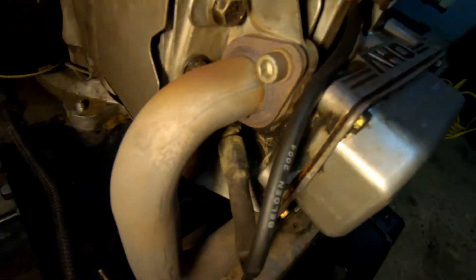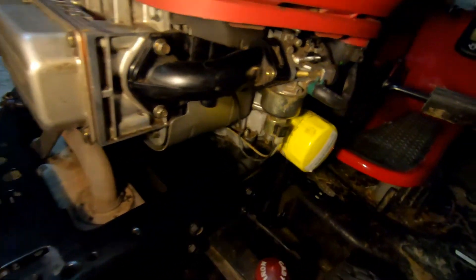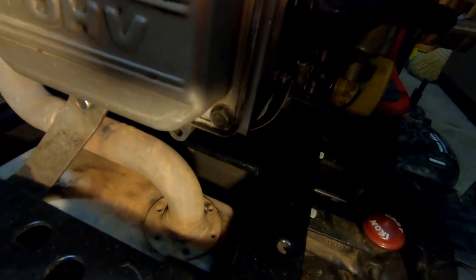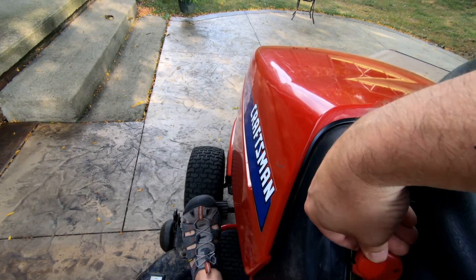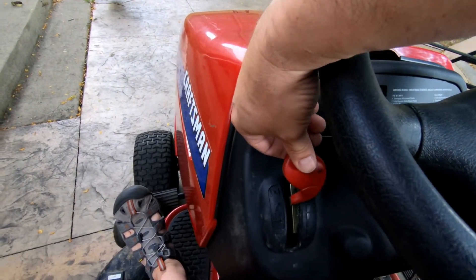Online everybody says it's an easy half-hour fix, but it's much longer than that when you run into something like this. You're going to need a couple cans of carburetor cleaner to spray off everything and clean out the fins, to make sure you get proper cooling so it doesn't seize up on you. In this case it worked out well — new head gasket, everything runs great. I hope this video helped you out. If it did, please click the like button and also subscribe — it's free.